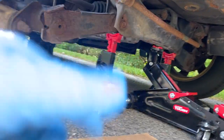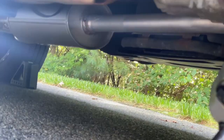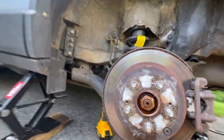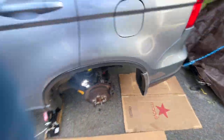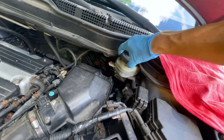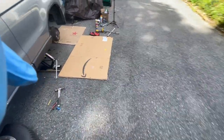Always safety first — as SMA says, 'safety third.' I got two jack stands there and the hydraulic lift. All precautionary: I chocked up the wheels and chocked the front wheels too — pretty safe to work on the car. I sprayed it with a little PB Blast here and in the back. Pro tip: when you're doing any kind of brake work, crack open the brake fluid reservoir — just get the lip loose — so when we compress the calipers back, the fluid returns there and we're not introducing air.